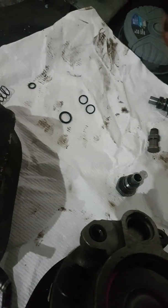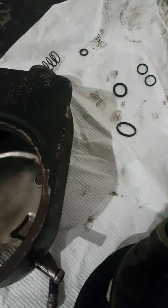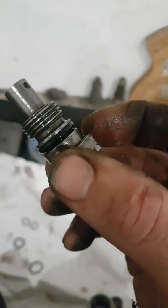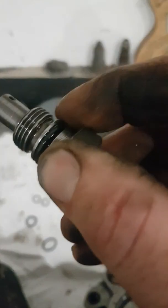I put a thick o-ring here and a thick o-ring here. The really thin ones — there are two of those also — maybe for a different application. Same thing here, the one's a little bit thicker, so throw one of those in there. O-ring here, o-ring here, o-ring here. Also with this part, if you have to reuse your old one, there is an o-ring right here — make sure you change that o-ring.